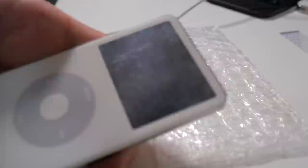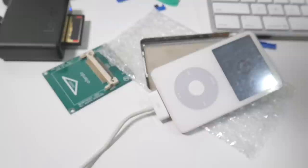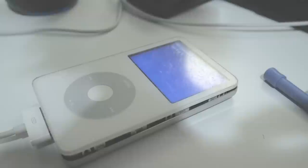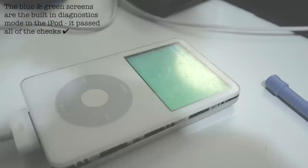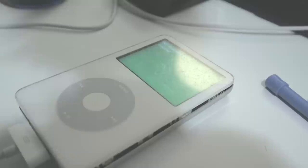I left the iPod overnight and got the same results. I've spent a while going back and forth with different methods of formatting the CF card, using different utilities to format and repartition it, even swapping the old hard drive back in — which still worked. I was able to enter disk mode on that and then use Carbon Copy Cloner to make a clone of the original drive over to the CF card. Still though, no matter what I do, when that adapter is installed, I get the low battery error. I'm not sure if the adapter is defective, incompatible with my CF cards, or otherwise just bad, but this approach of trying the cheap route just hasn't worked out. It's often more costly in time and effort to mess around trying to rig together cheap unsupported hardware than it would have been to just buy the quality supported stuff the first time.